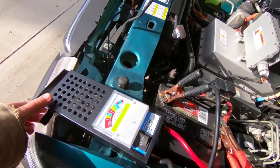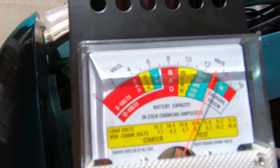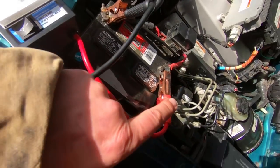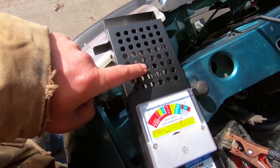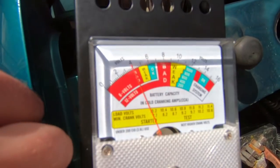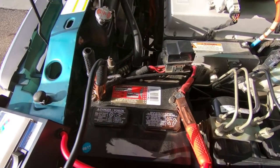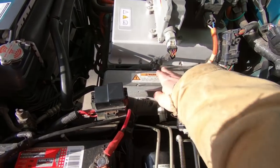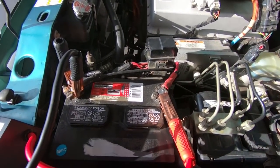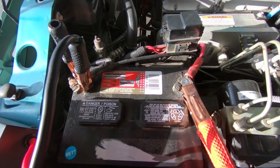I have a basic battery load tester from Harbor Freight. When you hook it up to the battery it acts as a voltmeter — right now the battery is fully charged. But if I press this button, it connects the battery through a heavy resistive load of 100 amps. Watch the voltmeter as I press this button — it just drops like crazy. That's definitely a bad battery. Whether it's plugged in to charge or the truck's running, the DC-to-DC converter outputs a 12-volt charging voltage, but when the battery's just sitting, it discharges enough that you can't start the truck and you can't charge it.